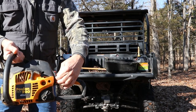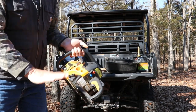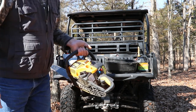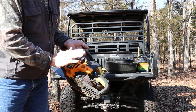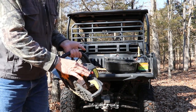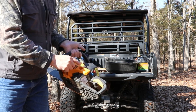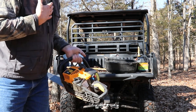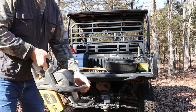That goes to a high idle choke and it makes the saw easier to start. As soon as you bump the trigger, you'll see the blue trigger go in, and that means the saw is ready to run. I don't use the primer bulb unless absolutely necessary. To me, it seems like you're putting too much pressure onto the carburetor seals and hoses — specifically in cold weather. If you get to pumping on this thing, sometimes it can push a fuel line off. That's just a personal preference; follow the manual and do however you choose.